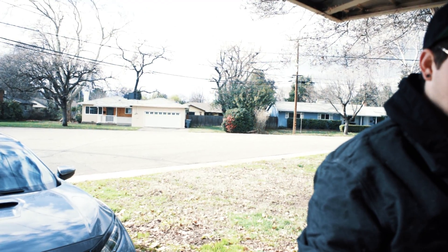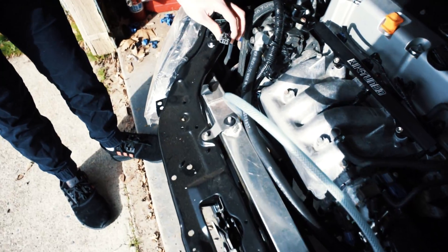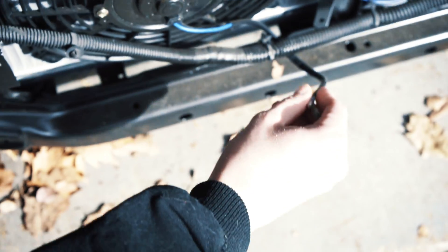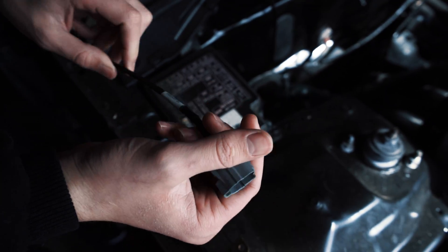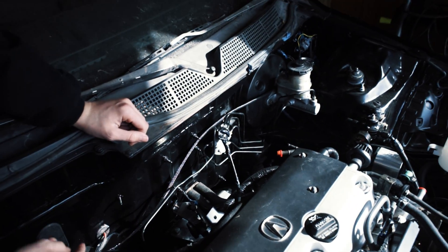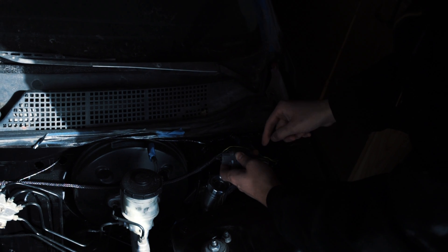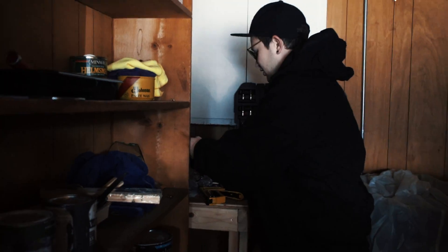I'm pretty sure I can just get a connector for the fans and connect that in. There's a primary O2 sensor on the conversion harness that goes down there. The two green wires with the block connector plug in right up here by the shock tower. The rest of it goes inside the car. Let me grab my K-Pro.